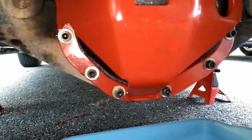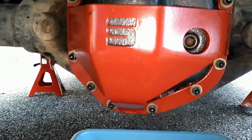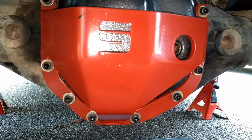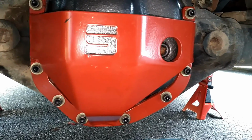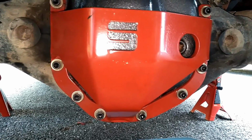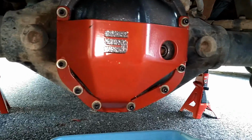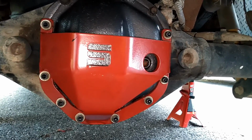That was 93,000 and change original miles of beating on whatever the factory finish was. So as I mentioned in the first half of the video, I took and painted this with a gunmetal metallic, and then baked it for 175 degrees for an hour, and then waited, brought it out, and so now this has been sitting for an entire day, and so I made sure that it had time for the RTV to properly cure, which is the recommendation from Permatex. They say do not go ahead and be in too much of a rush to try to put your machinery back in service unless you really, really need to.